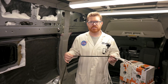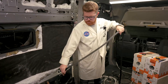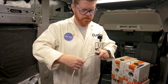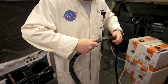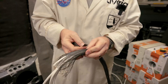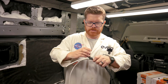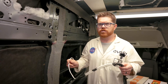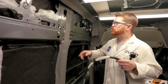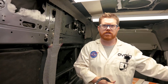With our wires bundled, we're ready to cut some protective sleeves to make pulling our wires to their desired location easier and give us a little bit of extra protection. Another quick thing that'll make it easier to pull the wires through is to tape any ends of those wires in so that as you feed them, they're not going to get stuck on anything. Now we're ready to start pulling this through the wall. With our wire loom ready to run, we want to think about what direction we're going to be running from. Because this control panel loom has a couple of extraneous things splitting off from this side, it's going to be easier to pull from this side back to my power station, since everything needs to come back there.